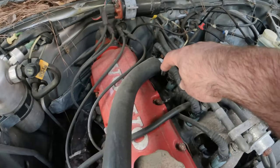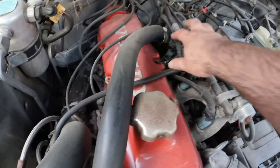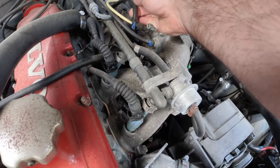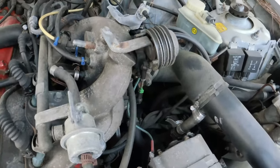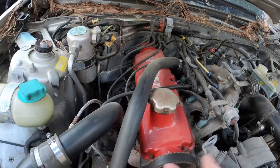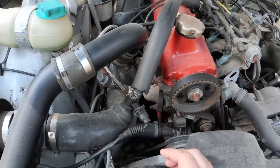This is the crankcase ventilation that comes from the flame trap down there — it's a little box. The box is basically an oil separator; it separates the oil and it's supposed to drip back down. There's a little three-way union here. It goes to a vacuum hose, and that vacuum hose basically assists vacuum for the crankcase ventilation when it's at idle, when the butterfly is shut. What that does is help the rings seal by putting a vacuum on the bottom of the piston. As those pistons are jumping up and down in the crankcase, there's a lot of turbulence, and this right here helps suck all that turbulence out.